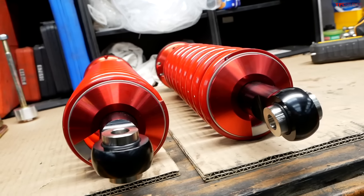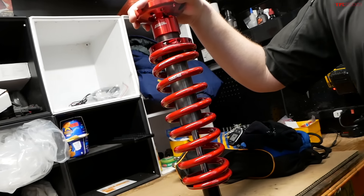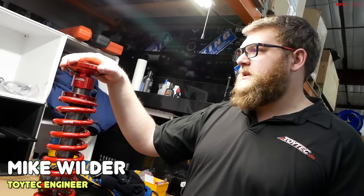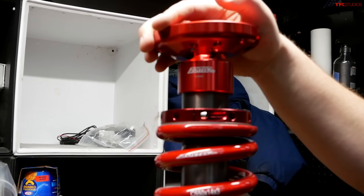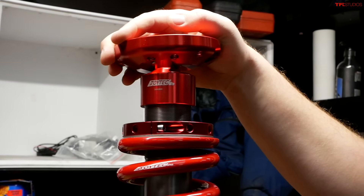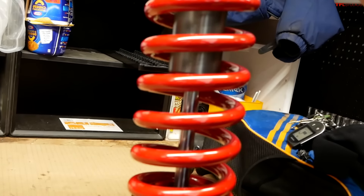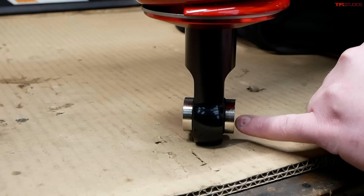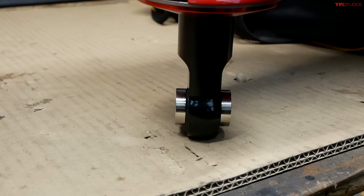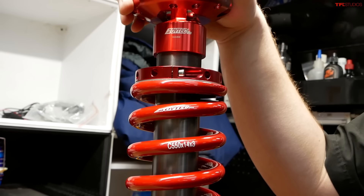This is our Aluma 2.0 series. We weighed a whole bunch of vehicles, went through a whole bunch of different situations, did a lot of measuring, and spent a lot of time to find something that is made for the typical Colorado driver. It's made out of aluminum. The shock pressure internally is a little bit lower than our last design. We've eliminated all rubber bushings so that we can beat it out a little bit heavier. It actually has a heim joint at the bottom that's sealed with a little ring, so it should last a long time. You can get a different spring rate if you absolutely need it for a heavier vehicle.